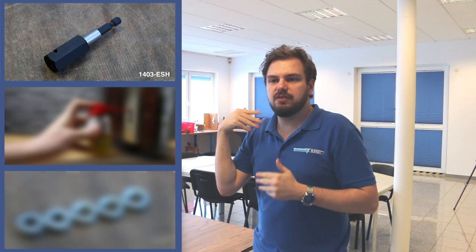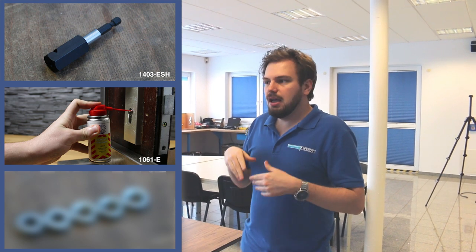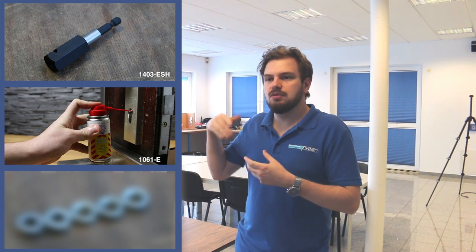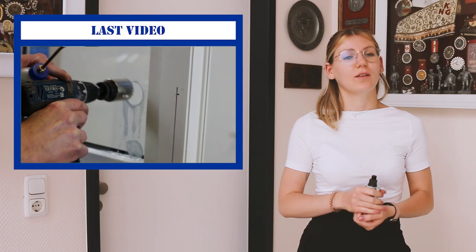We want it as straight as possible, which is why we developed the screwdriver adapter. The next thing is to use some kind of oil or lubricant to make it easier to screw in — this also avoids damage to the screw during insertion. And when you use the bell puller it's very important to use the washers as well. The washers transfer the power from the bell to the screw very evenly and help avoid breaking the screws.